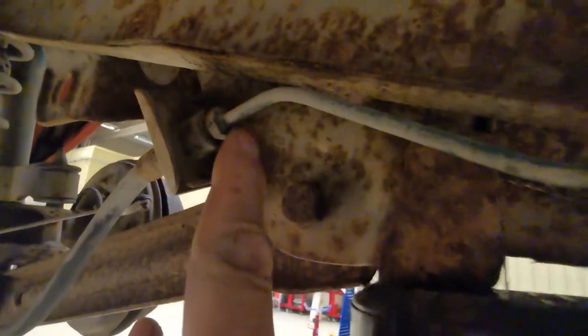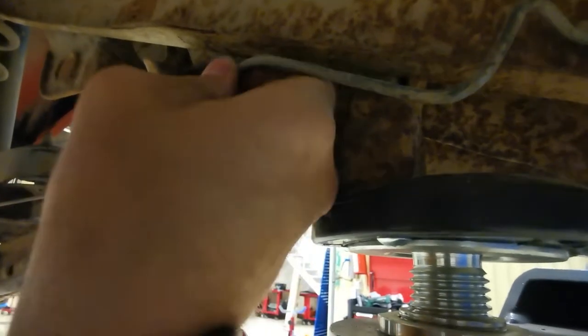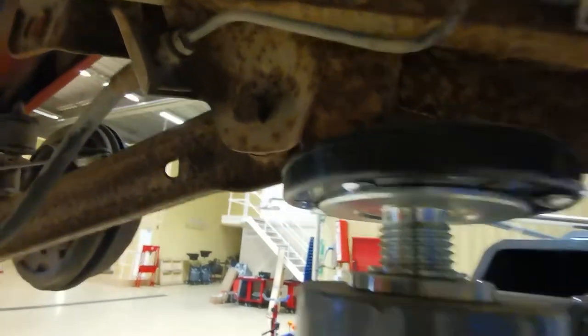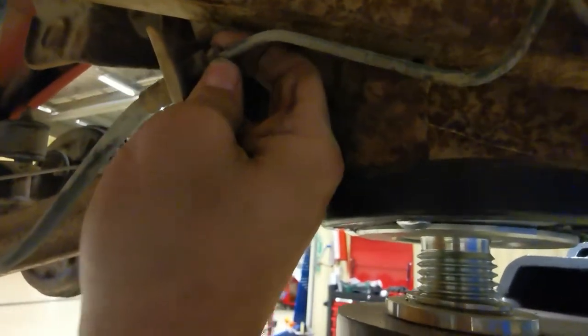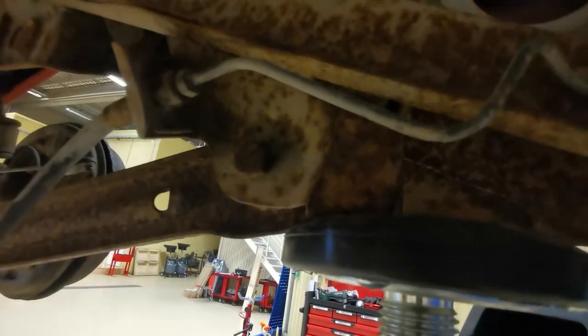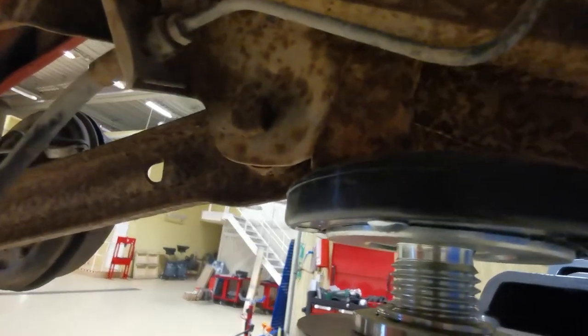Right, the first thing we do now is we need to get rid of that screw. These are obviously brake pipes, so they're only made of copper, these pipes, and they do kind of rust and get stuck. This one, they're all really, really clean, so I don't think I'm going to have that problem. But I've got special brake spanners. I don't have them with me, but the normal brake spanners, they go around there and they're missing one little section there, so they grip really tightly around there. You can do them with ordinary spanners, and they're probably what I'll use to do it.